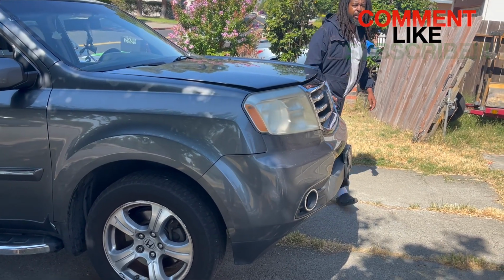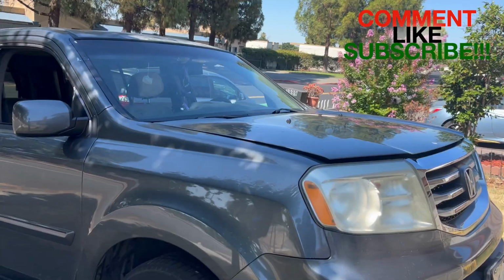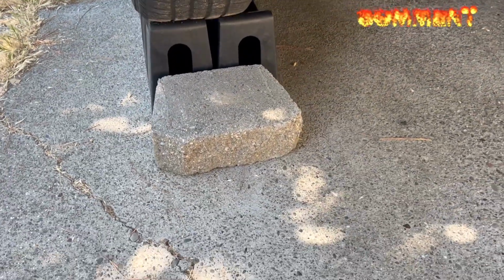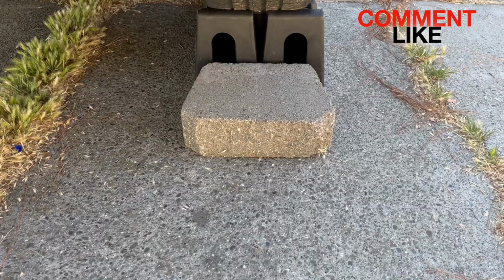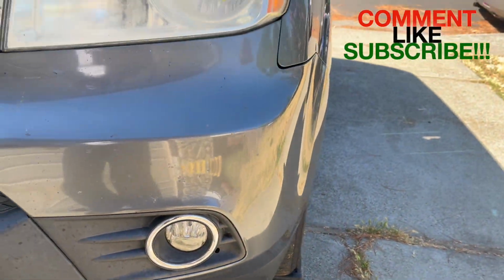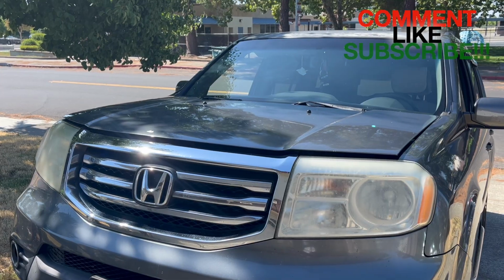And then after, you want to go ahead and inspect the ramps for safety, okay? So we're going to go around and make sure that the tires are on there good. Looks like they're on there pretty good, right? We're going to inspect the tires, and the ramp is not warped in any way, because you're going to be going under this car. You want to make sure that everything is taken care of, okay? Hopefully the hood is popped and we're ready to change oil.